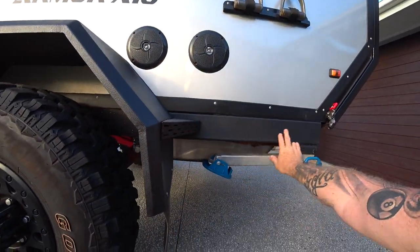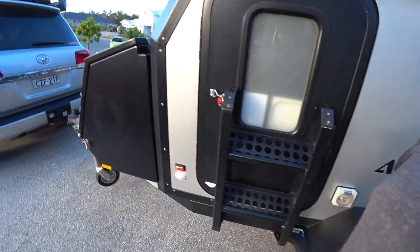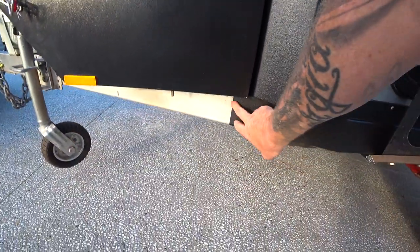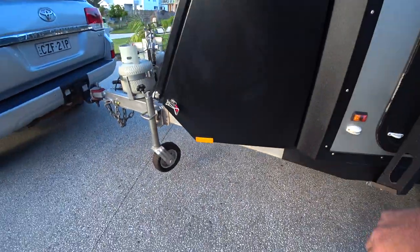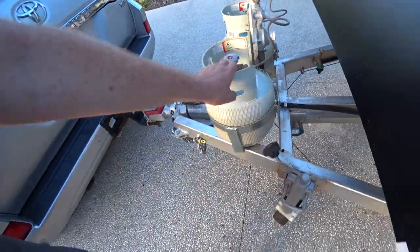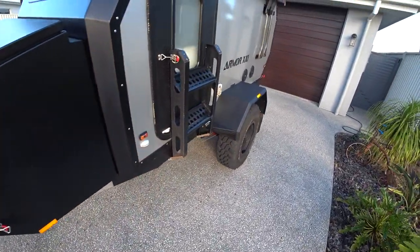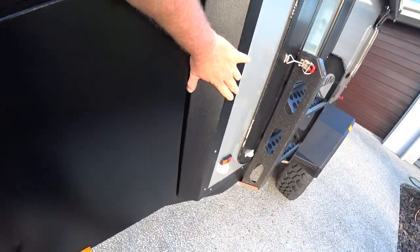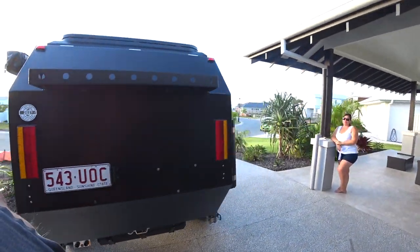This is that Raptor coating — it's pretty good. This is obviously stone-chipped; it's just that black paint they put on there. Don't think this stuff will be coming off. You can see the shadow line where I've masked that up — just these edges were getting hit. And again on the chassis here, this was just blowing off that paint. It's all hot-dip galvanized chassis — they've done a great job with it. A fabrication shop made up the brackets for the gas mount and they were impressed by the chassis — even the inspector. All the chains are properly rated. These are the stone chips you suffer — not much you can do about that. These strips here and this edge were like this before I got them wrapped.